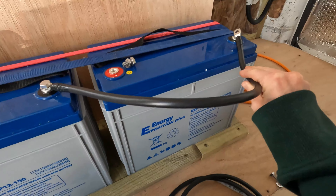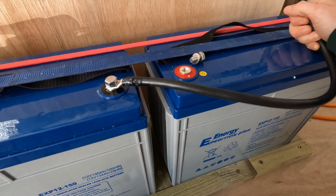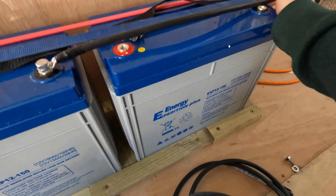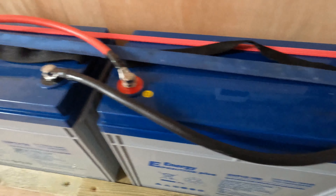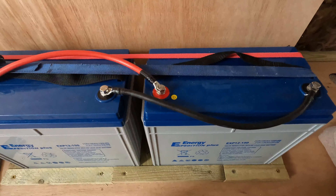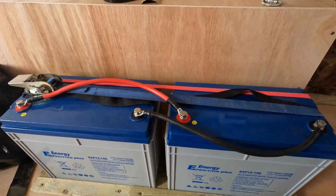I've made this a little bit longer than I anticipated and I don't really want it to be that long — you want as little resistance as possible — so I'm just going to shorten it. That's it all done — hooked up, kept the cables the same length to avoid any drops in voltage. They've all connected nicely, linked up in parallel. My negative will run to my fuse box and my positive for the fuse box from there, keeping those two lengths the same as well.